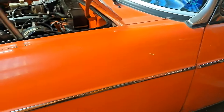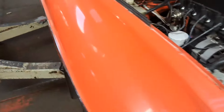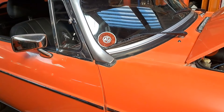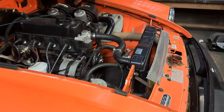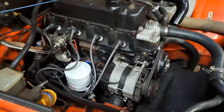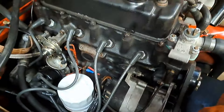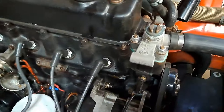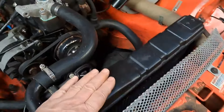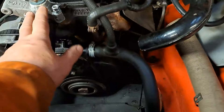The car's lovely and straight, there's no rust on it, it's in immaculate condition. Apparently he was telling me that it's been in an old boy's garage for the last 20 years and he's hardly used it. My mate Bleaky bought this from him and put it straight back on the road. It's pretty simple, it hasn't been messed about with. He says he's got no heater. I've had the engine running, got it up to temperature, temperature gauge on dashboard says normal, heater hoses are hot, thermostat housing's hot, radiator's lovely and warm, so we've got circulation.